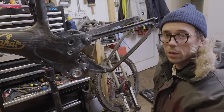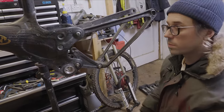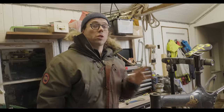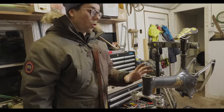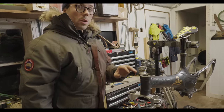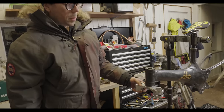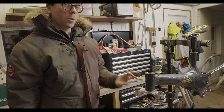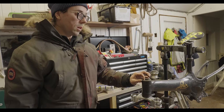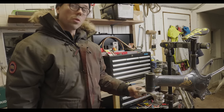We were trying to build a super bike, and what does every super bike need? It needs titanium hardware. Because the forks that I'm fitting - the Intend Infinity - have got a flat crown, whereas the Rock Shox had a sort of curved drop crown on the lower. The crown bearing had to sit on a spacer. So I got a spacer made up, machined up, with a small lip, so it sits on the inside race of the bearing, so it runs nice and smooth.